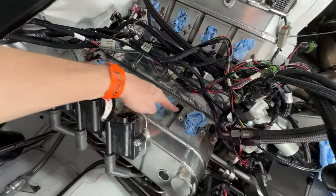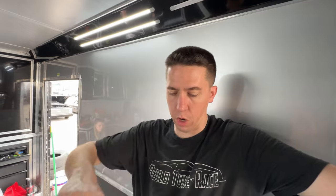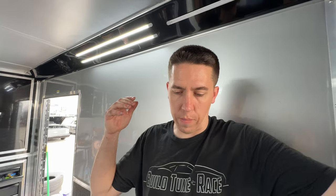All right, here we go. So plugs are in all the lower holes. What I ended up doing was taking set screws. I went out here with my hammer on the edge of the fuel can and smashed the top couple threads on the screw so then it couldn't just work its way down. I put a little bit of the right stuff on there and a little blue Loctite on each one and thread them down in there. If they don't ever come out, I honestly don't care. But I definitely don't want them auto rolling themselves down into where the cam and lifters and everything else are. So I smashed a little bit, set them down in there. They actually have a little bit of torque on each one of them. So I'm gonna let everything set, clean everything up a little bit, and then put the intake back on.